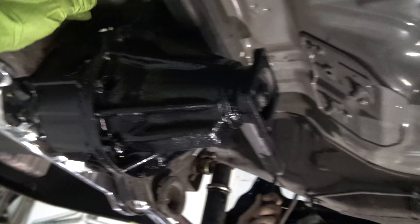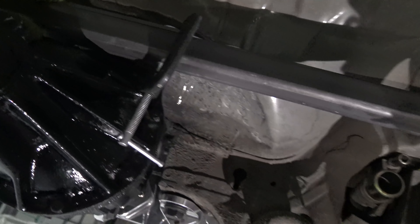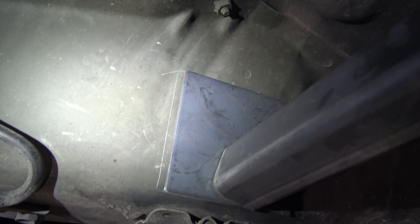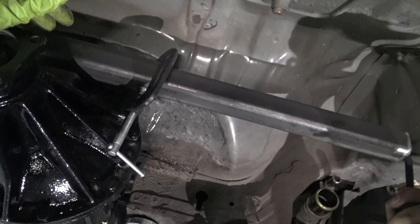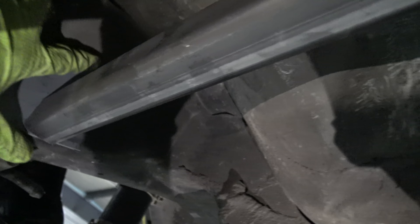We have the plate bolted at the top. I went ahead and made the holes a lot bigger up there — you can see all the daylight coming through. I went ahead and threw a C-clamp around it, basically holding this bar in place. You can see Ty's got a little bit of pressure holding this one. We'll push up the diff just a little bit when we actually go to weld it, so that bottom thing should be right at the bottom of the plate. I kind of outlined a little etch so I can clean all that off for bare metal. Plan is we'll clean this stuff up, get it to a nice weldable surface, tack this in a couple spots, tack the back notch, tack these plates on, then unbolt it, remove it from the car, and then fully weld it all the way around the plates and on the top piece. Then we'll stick it back up in the car and weld it fully in.